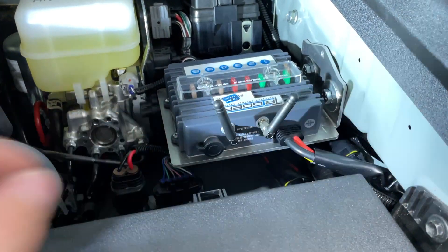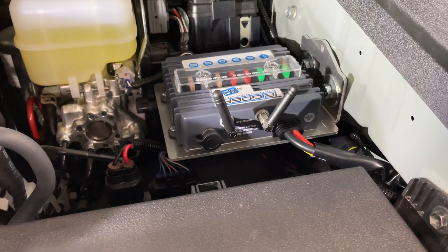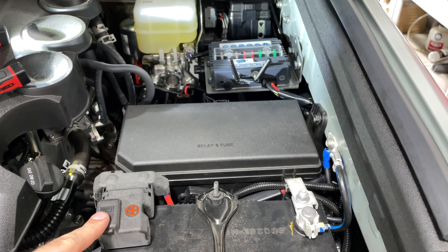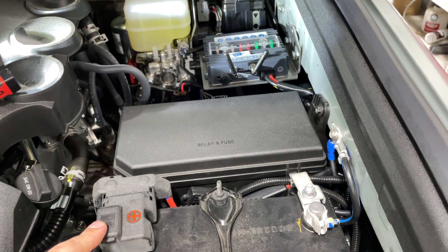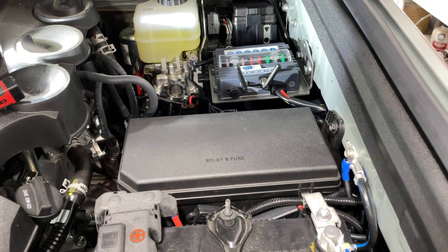This is a wireless accessory control system and it's literally got three connections. It comes with a wire — it's powered up to the battery with a big fuse — so power, ground, and it's also got a trigger wire. Some people wire that yellow trigger wire directly to the battery for full control, meaning the ignition does not need to be on.